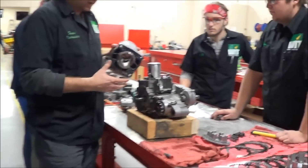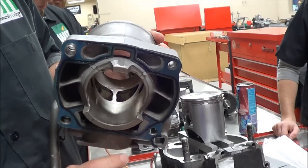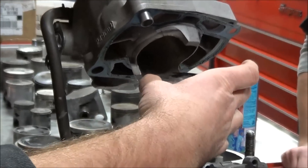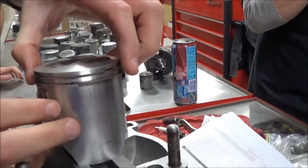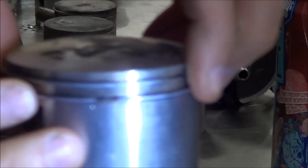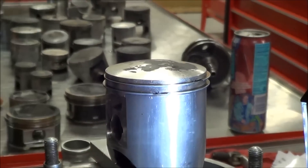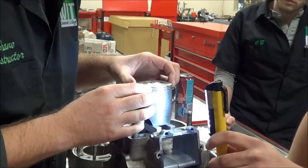We'll focus in here now and have a close-up. This area right here is so narrow compared to a lot of them — the skirts are pretty equal on most. What we're trying to do is take advantage of this lead-in and grab the back side of the piston ring so it leaves the side we need to compress. We're trying to compress this around so that the piston ring with its notched edges cradles that locating pin. Once installed, that locating pin is going to prevent the ring from popping out into one of the ports in operation — so it's extremely critical that we don't bend the ring or have any problems during installation.